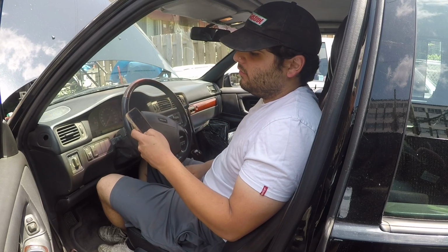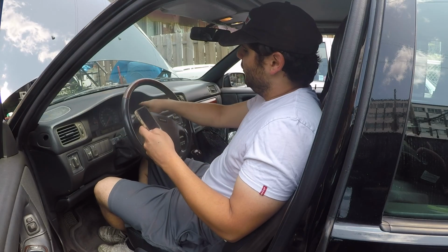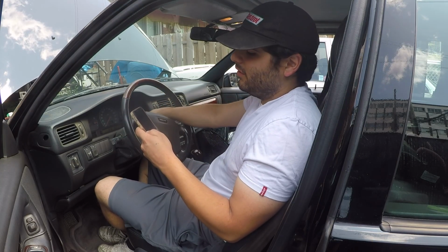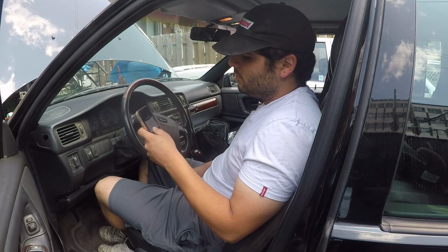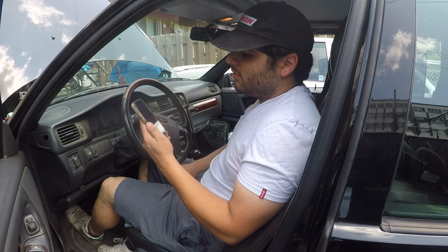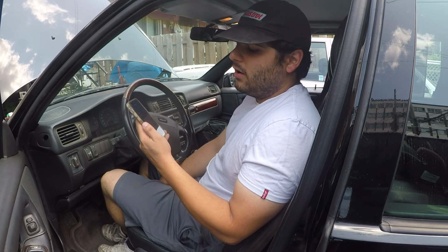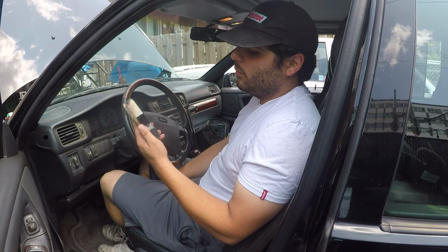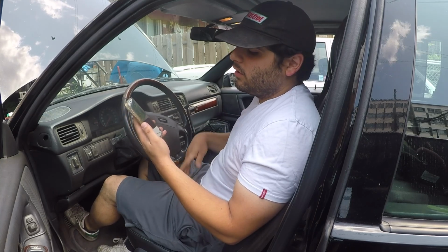So 99 S70, keep this vehicle. Read codes. I don't know if you can see the check engine light on camera, but it's right there glowing. That came on a road trip on the way back. So we've got EVAP system leak detected, large leak. We have already taken care of replacing the fuel tank cap a while ago, but it's also telling us to replace the purge valve assembly. So that's what we're gonna go for.